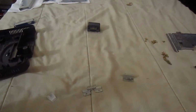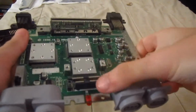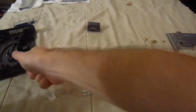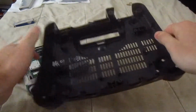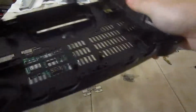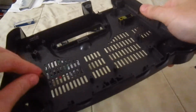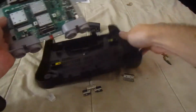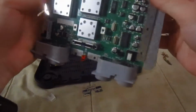Okay, so once you've gotten the cartridge slot cleaned up and the expansion slot as well, and all the metal and plastic parts are dry, we're gonna put this back together. First off, we'll be starting with these two parts. Remember, they go in one way, so that should be easy enough to remember. Okay, so for this part, we're going to put the metal shieldings back together.